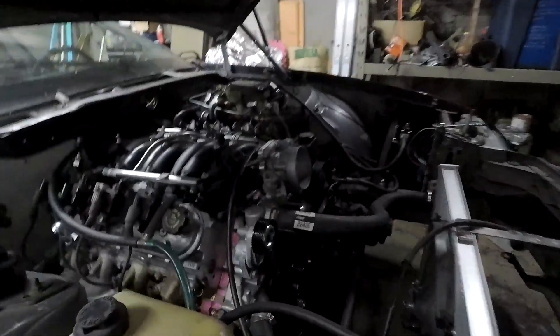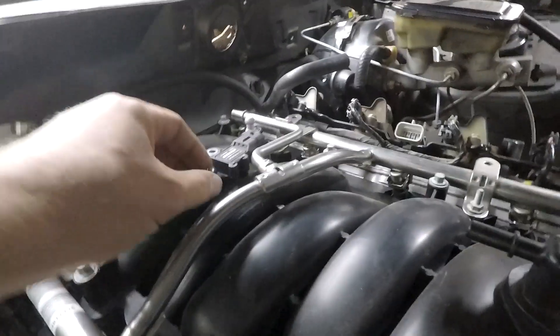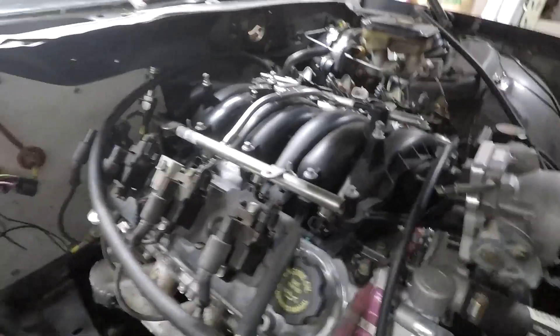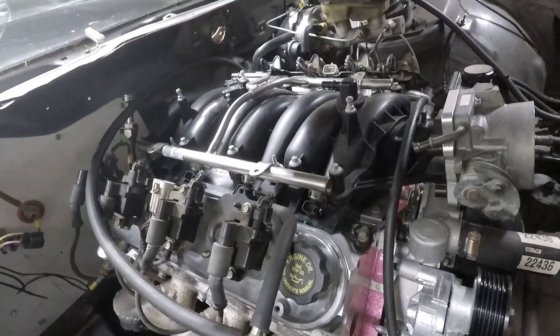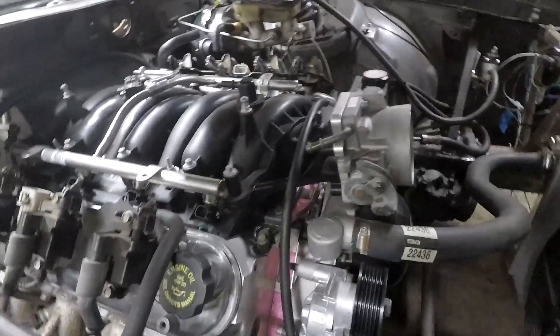Got it installed. Did the flow test, bolted it down. I gotta get a longer bolt for my MAP sensor — this is just a one-and-a-half inch, I think. That's fine, we're not boosting this. I still need some plugs. All I gotta do now is rip out the MSD harness and start putting in a standalone harness, then do the computer — I'll have to load up HP Tuners and tune it up. But that's where I'm at right now. So I'm wrapping it up, calling it a night. Be sure to subscribe and come back sometime. See ya!